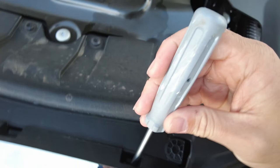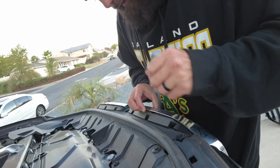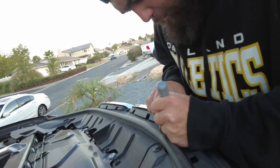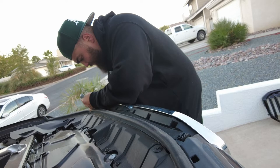If you look closely at the clip, you can just push it down and it should pop out. The actual clips for the full grill — I'm going to put a little bit of pressure on the tabs and kind of work my way out. BMW grills always snap, so just put pressure but not too much to where you're going to rip off your entire grill. I'm trying to just open the tabs up and it pops right open.